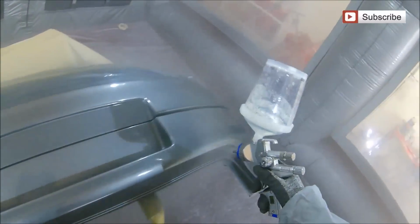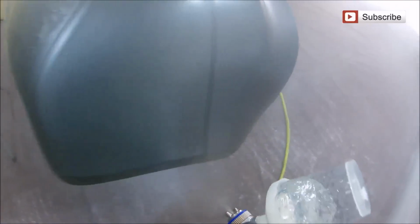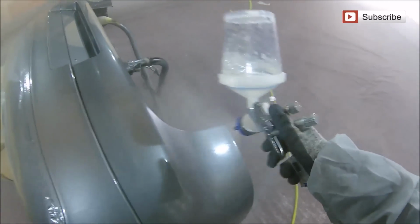for when the customer gets it back, and also I think leaves the job looking a lot cleaner than just painting that bottom section. And again, doing it this way, blending out that base coat just through that little middle section of the bumper bar and keeping it off that edge, means that also when the customer bolts this back on, they're going to get a really nice clean colour match on their job, because however well that matched before, it's going to match just as well now.